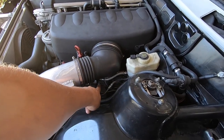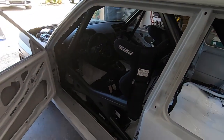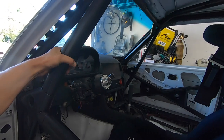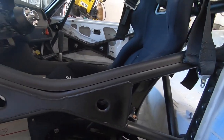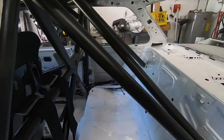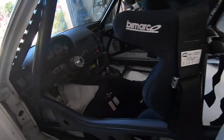This car was originally planned to be a hill climb car — I used to live in Connecticut and was going to run with the New England Hill Climb Association, racing up ski access roads. So I built the cage for that. It's built to NASA Rally Sports specifications: all inch-and-three-quarter DOM tubing with 95-thousandths wall.